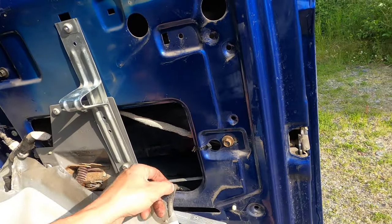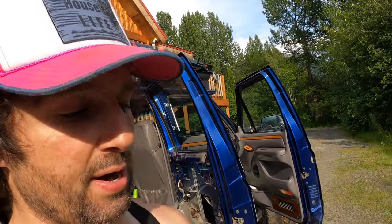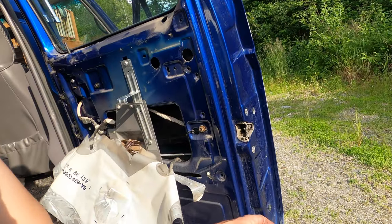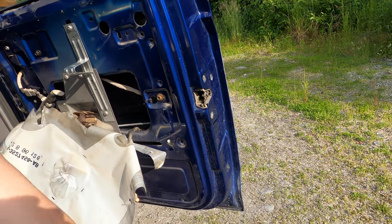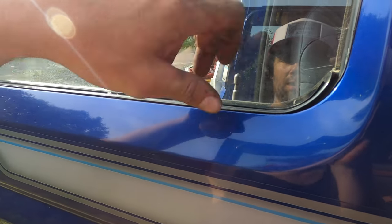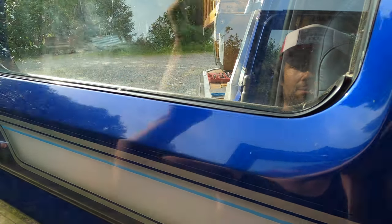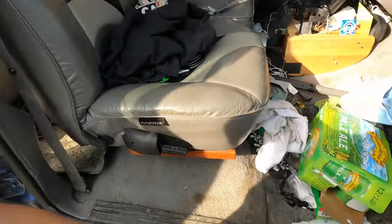At the bottom of your actuator there's a cable and a plug, and it turns out that plug is pointing straight down — so it's easy for gravity to shake it loose and fall. My plug was totally disconnected at the bottom of the actuator, so I just grabbed the plug and plugged it back in. I also put a new doorknob post on — if you break one off, you just unscrew it right there, grab the knob, unscrew it, and it comes off. To put the new post on, just screw it on — super easy.